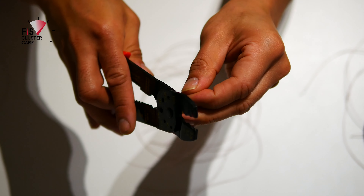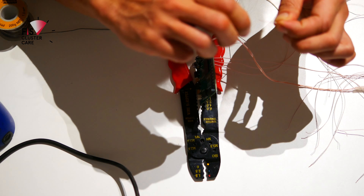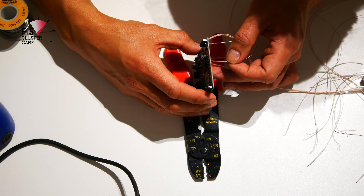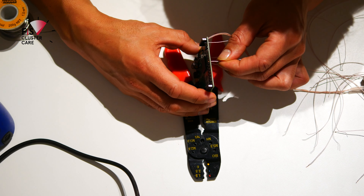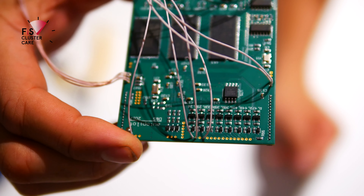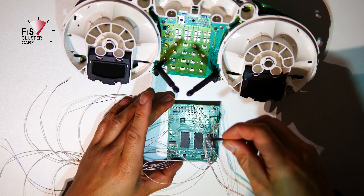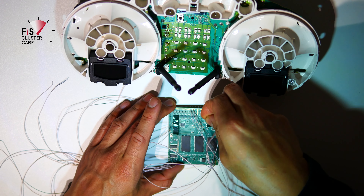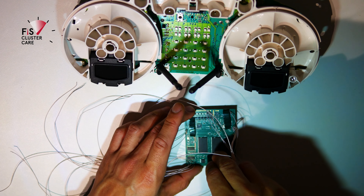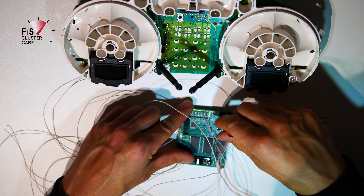That's all that's required for the instrument cluster for now. Prepare the ColorMFA kit by stripping down the wires, soldering them as per the Audi TT Mark II wiring diagram which will be shown on screen. Place the sticky pads and twist all of the CAN bus pairs, then thread the wiring through the holes in the board. There's another video for generally preparing ColorMFA — click the link in the top right corner to view the quickest way to prepare ColorMFA.